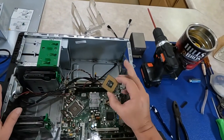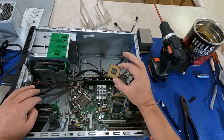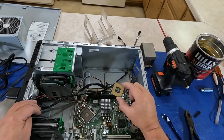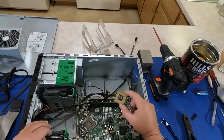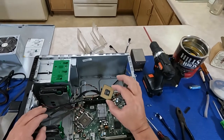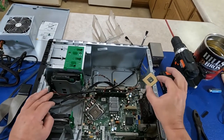This chip is pinless, and for gold recovery it doesn't even make the top 15 based on gold content of CPU chips. The number one chip you're gonna run into hopefully is the Pentium Pro plastic — it's a black chip and has about 0.55 grams of gold in it. If you go down to number 15, the Intel i960 chip has about 0.17 grams. Don't be fooled — it takes a lot of chips to make even a gram of gold.